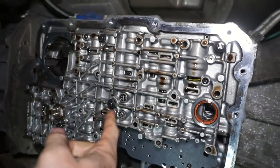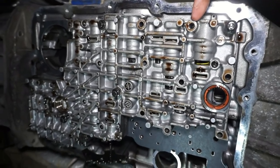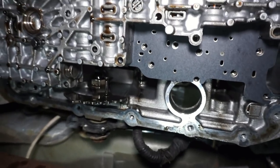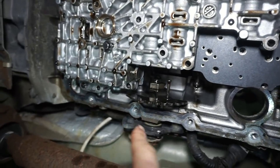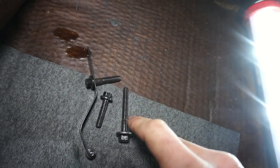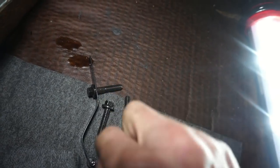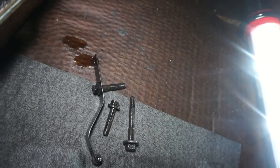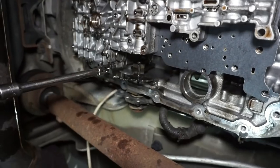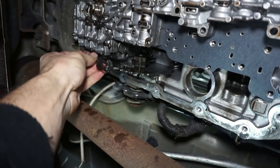Okay, so I got the valve body up now. I just kind of hand-threaded in a few bolts holding it in place. There are going to be some differences in the bolts going back in — this one here has a 10 millimeter bolt head, there's one underneath that has a shorter bolt than the rest, and one back here is for the little detent lever. This one is a longer bolt with a 10mm head, this one has an 8mm head but it's shorter than the rest, and this one I just left in the little detent lever. I'll thread in the 10mm, hand-thread in this little shorty, and zip this thing in.